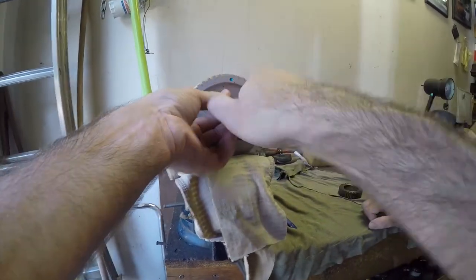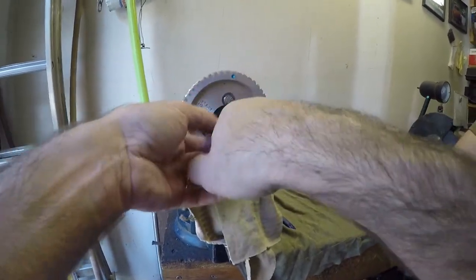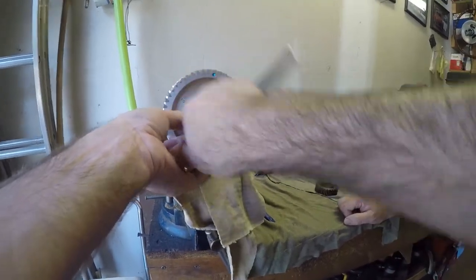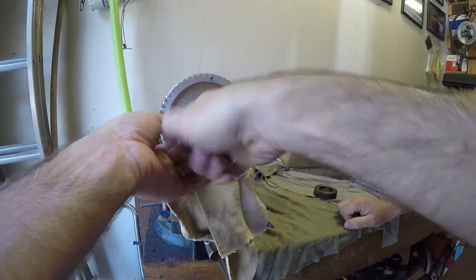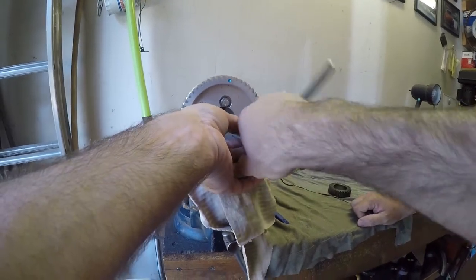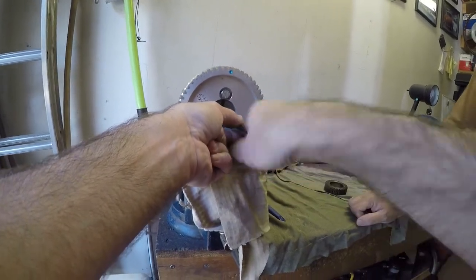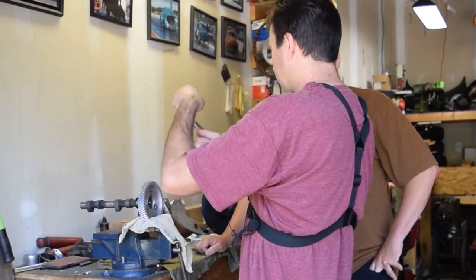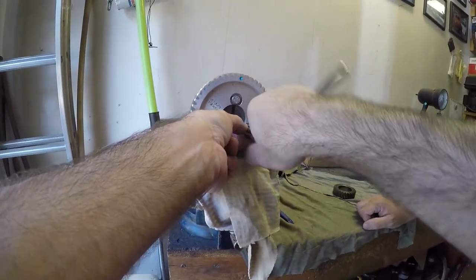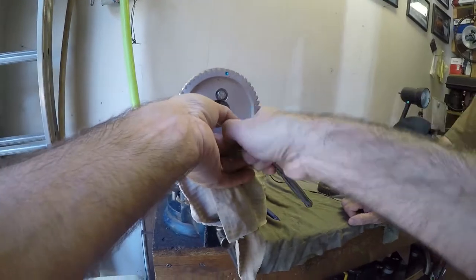We don't need to do that because Mike's not really wanting to go fast. Right now I'm just trial fitting the bolts to the cam, but I will use a lock washer — I like to use the wave washers — and Loctite. First time I put one of these together years ago, one of the first engines I ever rebuilt, I used the washers that came with the bolts, those star-like washers with the little ends on them. They all broke, and I turned my non-adjustable cam gear into an adjustable cam gear because it sat there and rocked back and forth and wobbled out the slots.